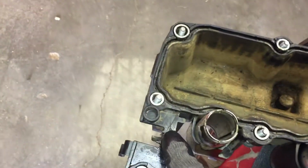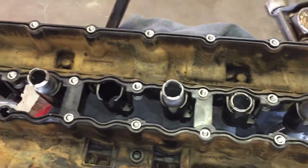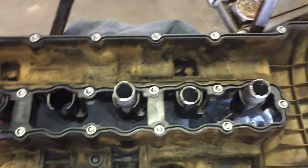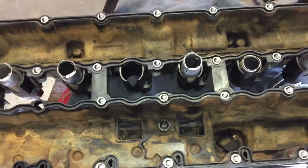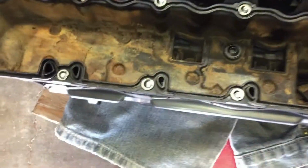And then there's another one back here. And honestly guys, I didn't pull on it. I never force anything out. So I know that's why it was leaking real bad, guys. For a spark plug to get fouled up, full of crap like that, y'all seen how those spark plug ports look. So that's the thing. It was just leaking like crazy through here. Right there, and I haven't really inspected it. I'm sure there's probably another crack somewhere.